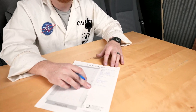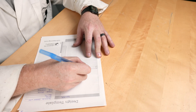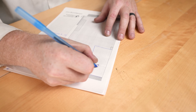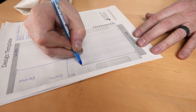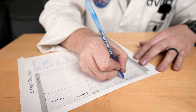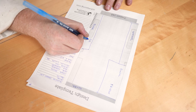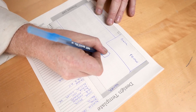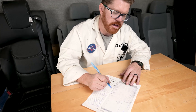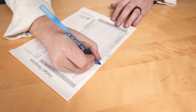Now that we have our list, let's start drawing those items on the map. We're gonna have our heater here under the front seats, our kitchen on our driver's side in front of that window. Our fridge is going here, and our sink is going on this side. We're gonna have our utilities and water on our driver's side rear utility. Our power is gonna be across the van in the opposite utility, and we're going to be using a Goal Zero 3000X. Let's not forget our fan on the roof — it'll be central here. Anything going in my overheads I mark along the edge of the template, so I remember those are going up on the side of the van and not on the floor. So these are gonna be all my things to my overheads, which is gonna be my light power and maybe some USBs up there.